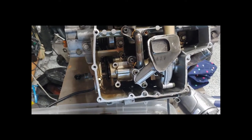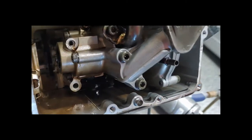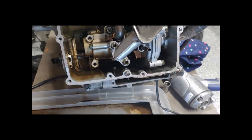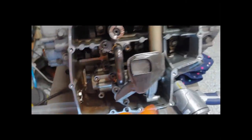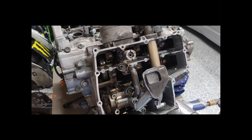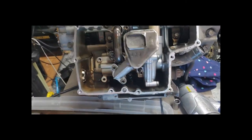I'm still trying to get this oil pump chain free. I'm going to go ahead and get that freed up, then start splitting the larger bolts and getting this case apart. I got the chain out — the lower sprocket is held in by a 10mm nut that is Loctited in. I grabbed the chain and sprocket, being careful not to hurt the teeth, took a 10mm wrench, loosened it, and popped the whole thing off. Now we're pretty much free to go. The only thing still connecting the upper block other than bolts is this hose right here. I need to disconnect it, pull out the outer case bolts and the inner case bolts, and that should free this whole thing up and let the case split. Then we should see the transmission down in there.